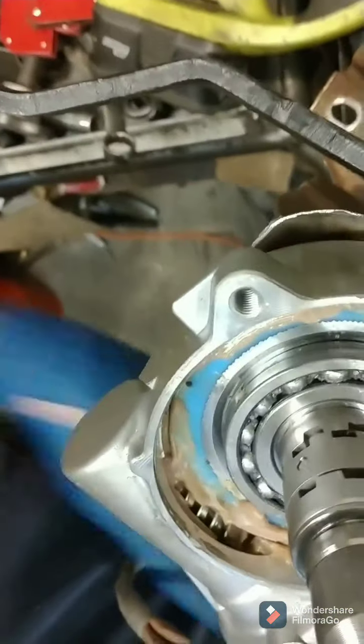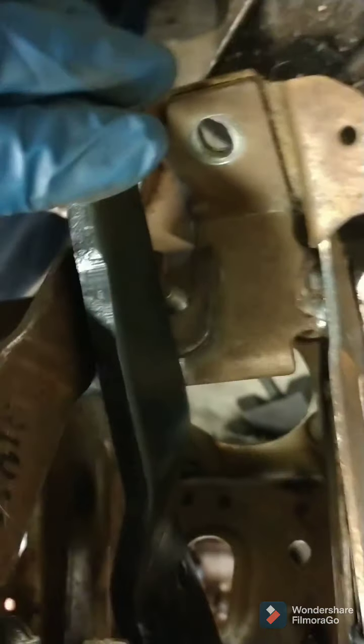So now that I have the whole thing out and there's no weight on the power booster, I got these guys in all the way, but it's still up. You see how it's on an angle? That affects the angle up top, and that one's even further. You see? I'm actually using the brake pedal to push it down, but it needs to go down more. It's not hitting here. Okay, that's clearing. It's grazing, and I mean grazing this.